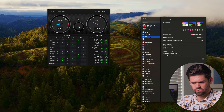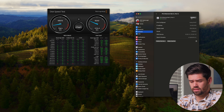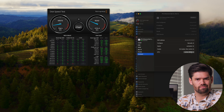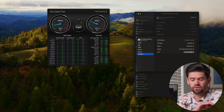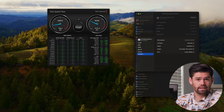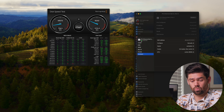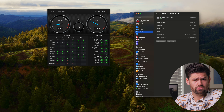Let me pull up the network settings. Right here in Network, we can see the 25 gig card and its settings — pretty straightforward. I did have an issue before turning on jumbo frames, but after reading the manual I enabled jumbo frames on the switch, the server, and this device. Since then, I've been running this for about two weeks with no problems — I even take Zoom calls over the 25 gig ethernet. I just had to add the Sonnet driver, set it up once, and haven't had to touch it since.